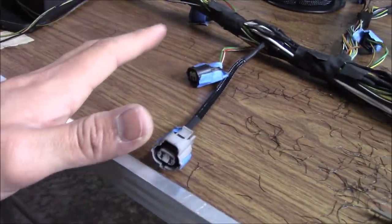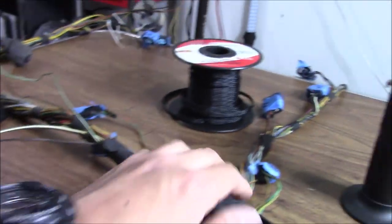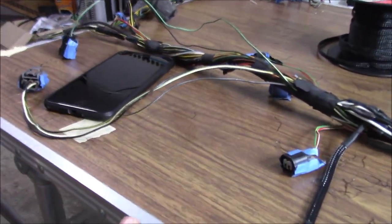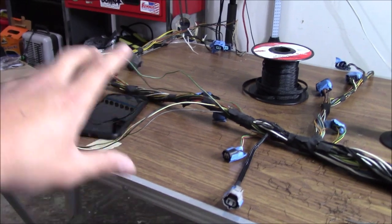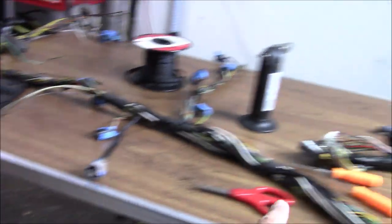You can see at the top of the heat shrink some of that glue that melts out — you don't have to worry about it too much at the top, but right here at the bottom you can just see kind of the transition: heat shrink, some of that shiny glue material, and then the braided loom. This is our first leg — it goes all the way into the harness, shrink wrapped under there. Now you're just going to do this same process for each of these legs until you get all the separate ones done.